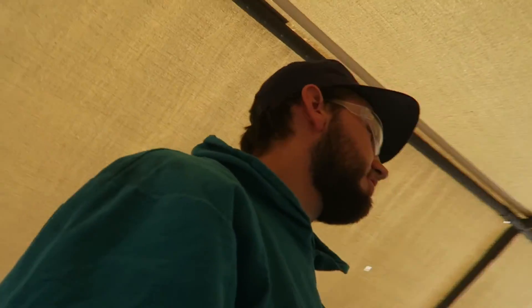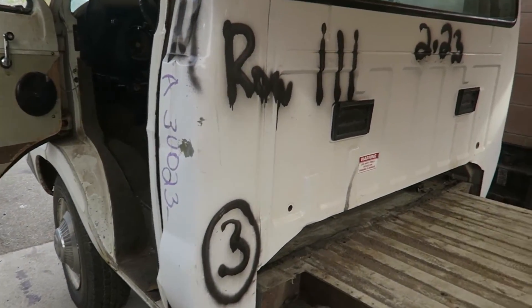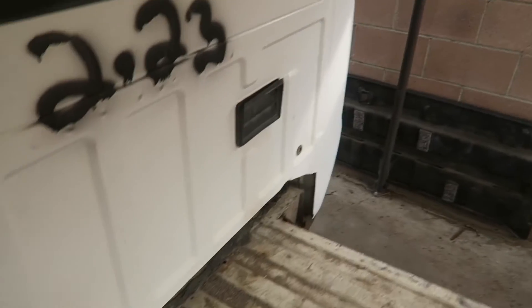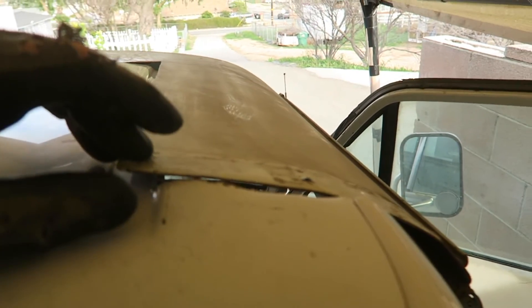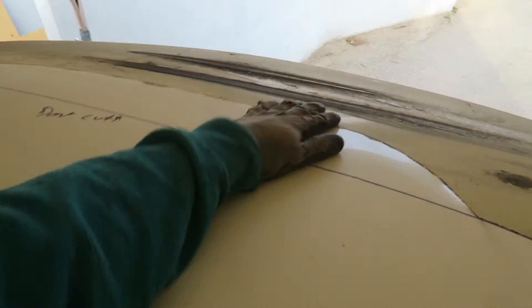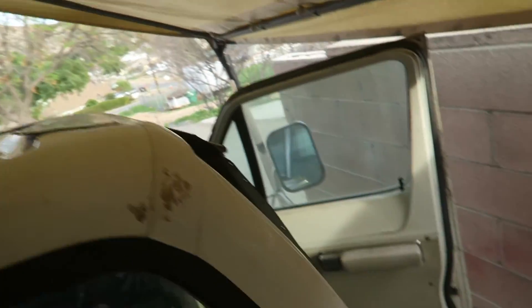About six hours into it and this is my fit so far — you can actually push that in a little tighter. On the top there's a flange that was already there from the way the roof was on the F-350, so I'm kind of using that, overlapping it — a flange type thing on both sides. That section I just showed you, I made a template for it. I've got a bit more trimming to do — I made it about a quarter inch too big, maybe less, which is barely too big because there's a flange on the Dodge's roof too. It's coming along great.